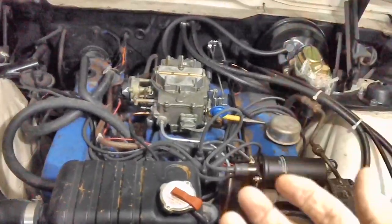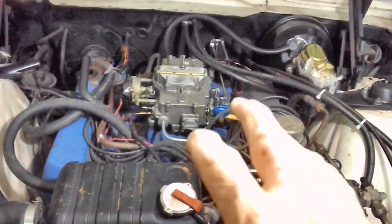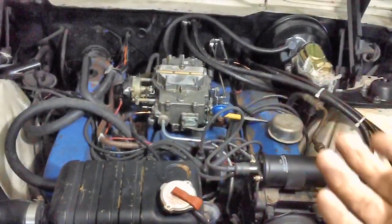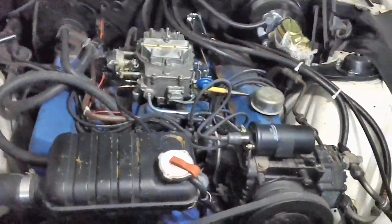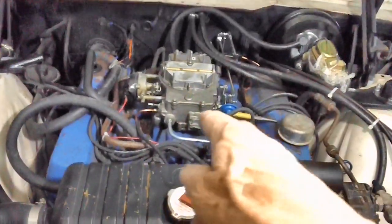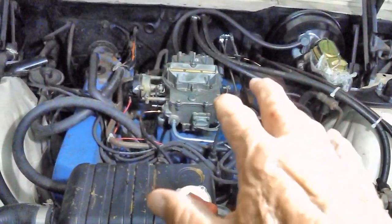And the basic bottom line is, once you get the vacuum set at whatever's required by the engine, usually between, I don't know, 17 to 21, 22, somewhere in that area, preferably up around 19.5, which is what they called for with the gauge I already mentioned. Once you get that balanced out right by adjusting your idle screws here and all that jazz, your engine should be pretty much fine. It's not going to be jumping around and rocking unless you've got a problem.